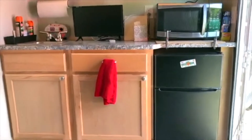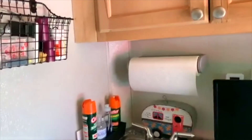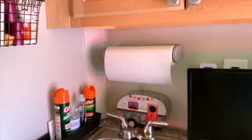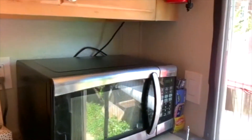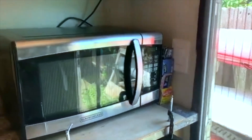One of the interesting things about this trailer is that the nose wall is curved, and as you can see from the corner fiberglass panels, there's a curve there — actually a three-inch radius on the outside in the sheet metal. As a result of that, and the fact that the door on this trailer is so close to the countertop, it called for a couple of solutions. One of which is that the wall behind the cabinets is a straight wall, and I actually built it that way so the countertop would be straight, because I didn't really want to build the curvature of the trailer into my finished product.